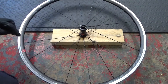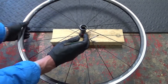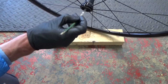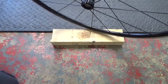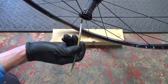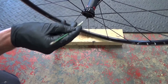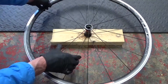Now what you want to do is clean up all your parts - clean up your hub, clean all the old grease out from inside it and wipe that all round. Then we're ready to go ahead and install a couple of new bearings. Once your hub is cleaned up inside, apply some grease around where the bearings are going to sit on both sides of the hub.